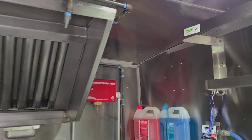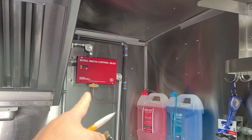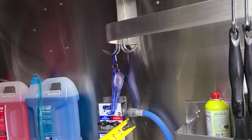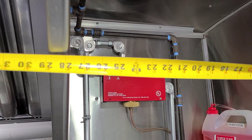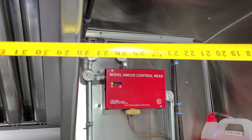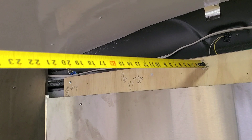Frank Baltiers with the DIY series — how to build your food truck, exhaust hood version. If I'm trying to get the duplicate of exactly how my food truck looks, even with the suppression system and the hood, I want to get the exact measurement from here to the wall. So I take my tape measure, put it to the stainless steel wall, bring it over to the hood — I'm at about 28 inches. We're going to go to the new food truck, measure out 28 inches, and that gives us the guideline to cut the hole into the trailer.